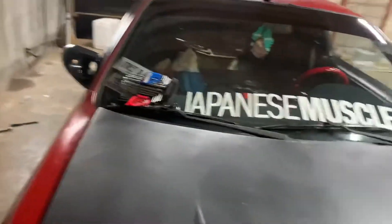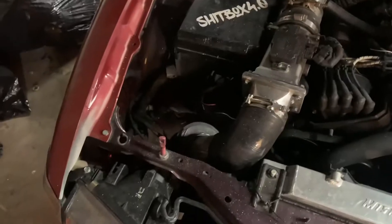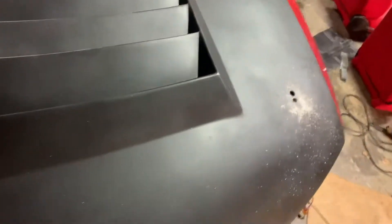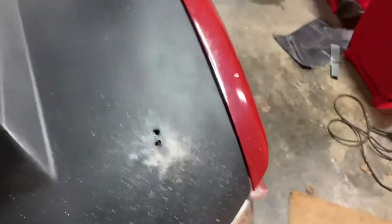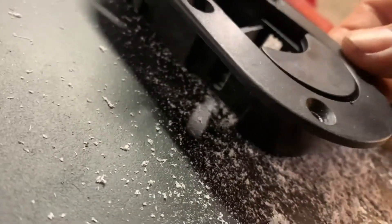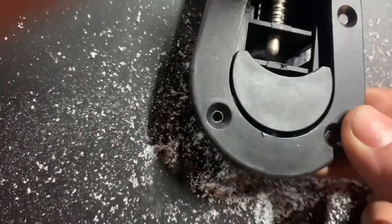This is how it looks. I got both sides of the hood spacers in and the hood actually fits a lot better now. I still have to find out what on this side keeps the hood from going down. But I can pull it down if I use my hood pins, which I just started drilling on. I kind of missed the hole at first, but looks like it needs to be a bigger space — so about right here. I'm pretty much set on that hole, just need to go a little bit left.